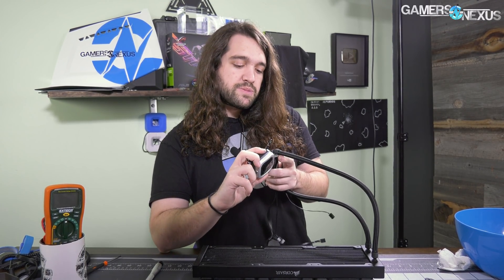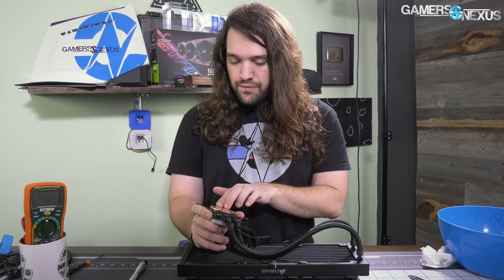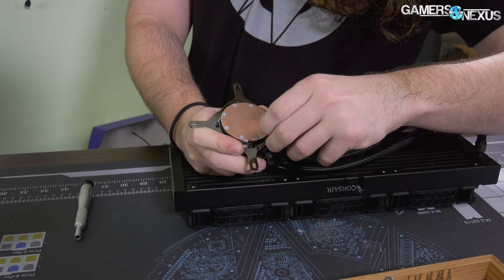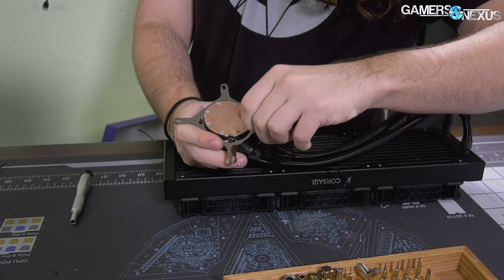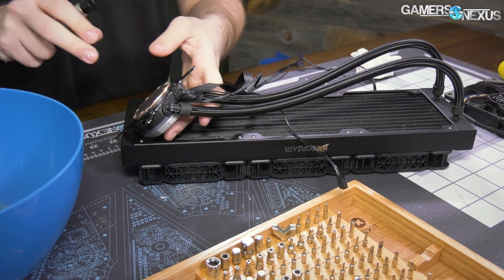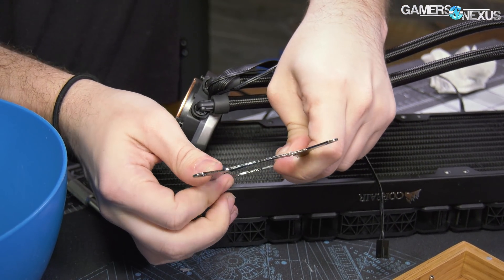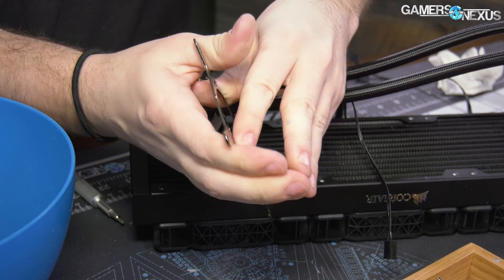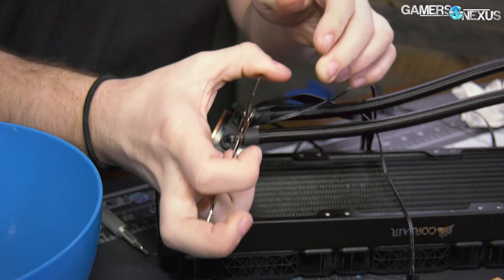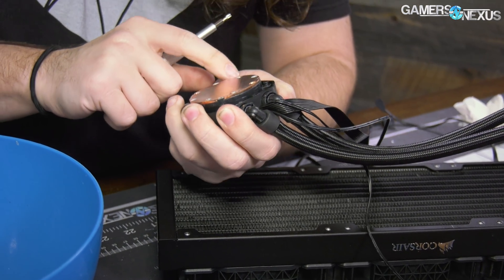The main changes have been for reliability and endurance — that's what Asetek's been driving home — and then LEDs. So let's take it apart. It's got eight Torx screws; I think that's a TR9 or TR8. They moved to Torx screws and I'm hoping these are easier to remove than previous ones, since historically Asetek coolers have been really annoying to take apart. The plates also seem slightly more durable — doesn't feel quite as easy to bend in one hand anymore.